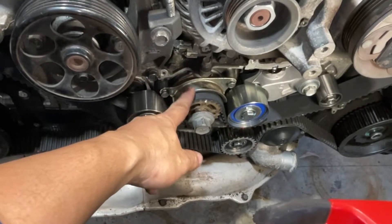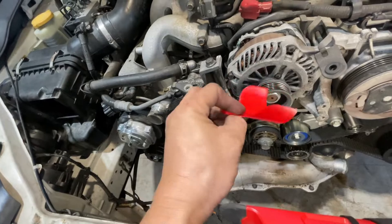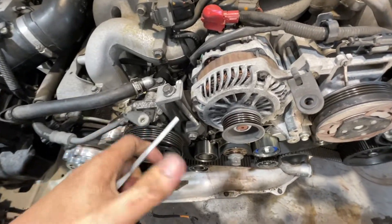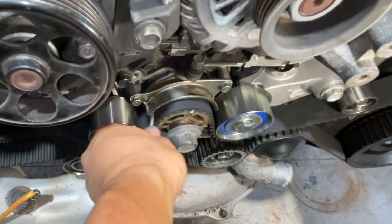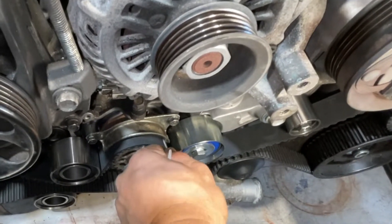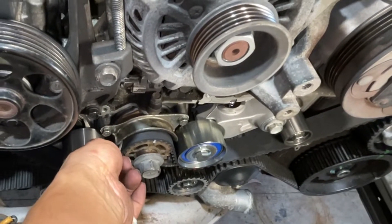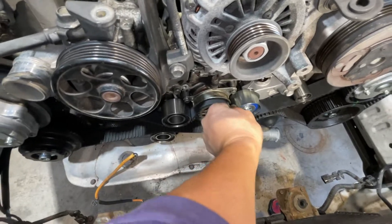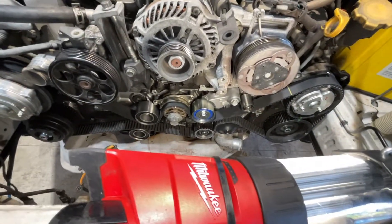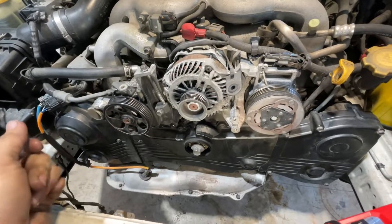Take note — don't forget this plate here. If you don't have the special tools from the Gates kit, a simple tip: grab a zip tie and if it passes through, the clearance is okay. See that — it passes the zip tie on the other side too. A little friction but it passes through. Tighten this 10 mil and double-check it won't hit the belt and destroy it every time it turns. Then I put back the cover — magically put it back — one, two, three, cover back.